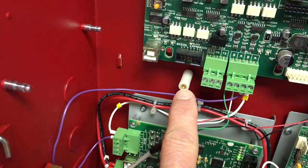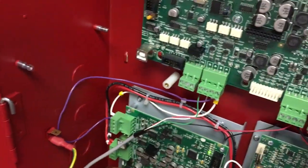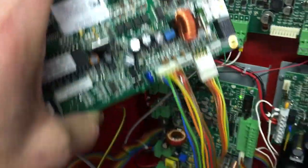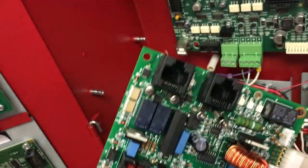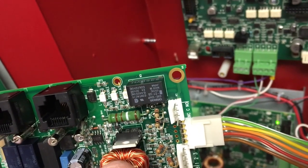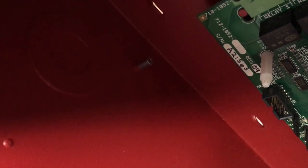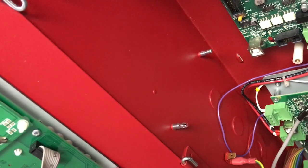I've put the standoff in place, gave it a little twist, and got it ready to go. I've also got my digital communicator with the SEB card and ribbon cables all attached. Looking closely at the digital communicator, in the upper right corner there is a screw hole — that will be mounted into the back corner, and that is the screw that grounds out the digital communicator. The other remaining posts are just snap-ons.